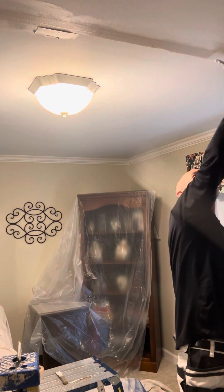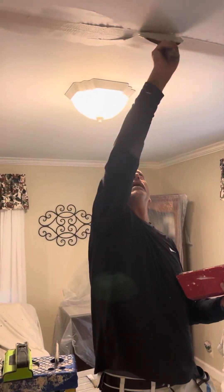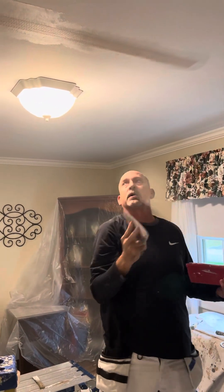I'm just getting the tape on here to stick with a very thin coat. I want it thin because I want this to dry quick so I can get back at it and put another coat on probably within the hour. I'm going to set up a fan to kick this patch into drying faster and get my additional coats on. I'll do a fine sand after three to four coats and it'll be ready for primer and then paint.